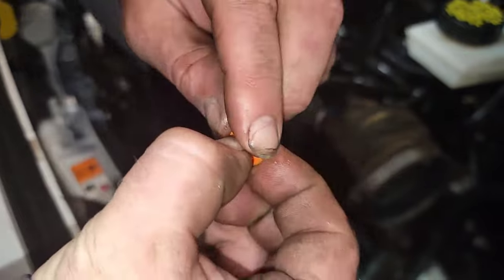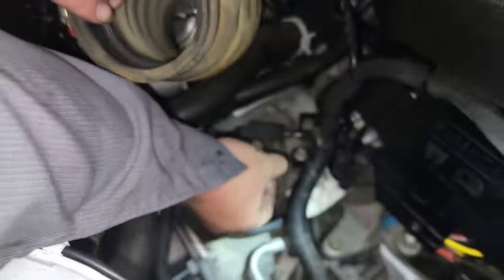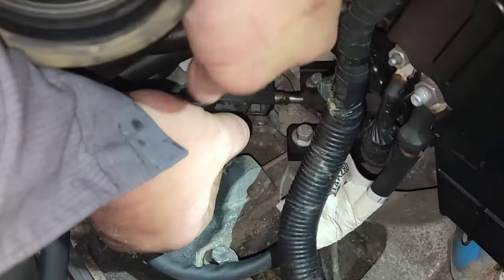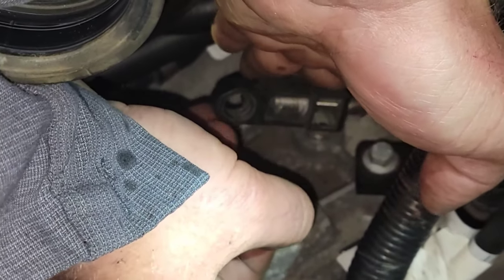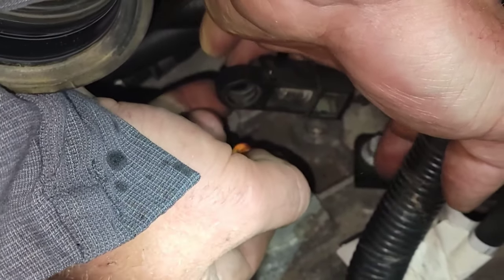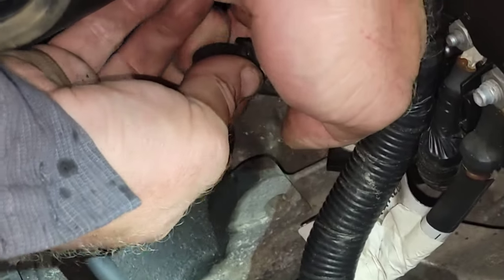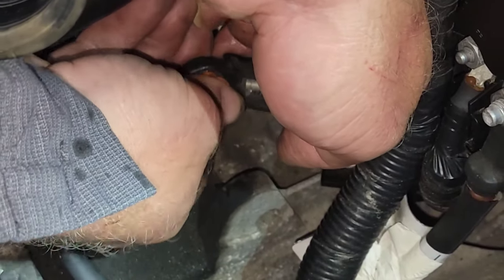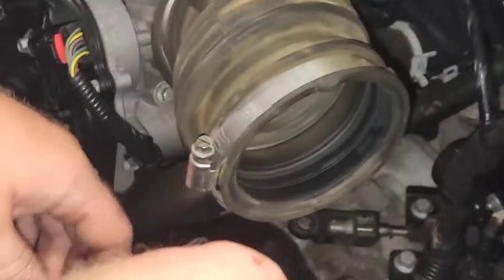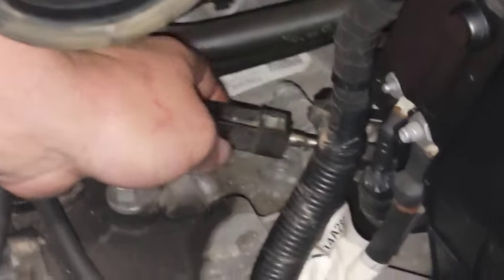I just took a little bit of grease and put on there — not very much — and I'll wipe off any excess once I get it in. From the flat side on the bottom, I'll take this bushing and start it, and sometimes I can get it to roll in without using tools. I'm going to try to do it with no tools.